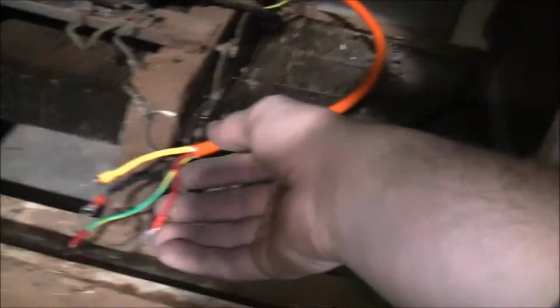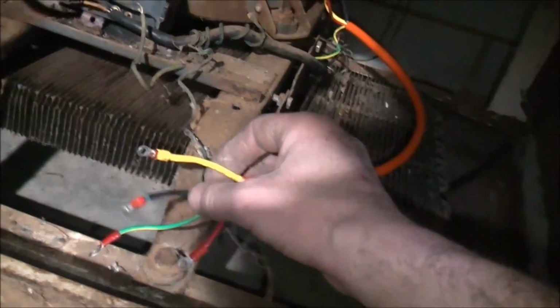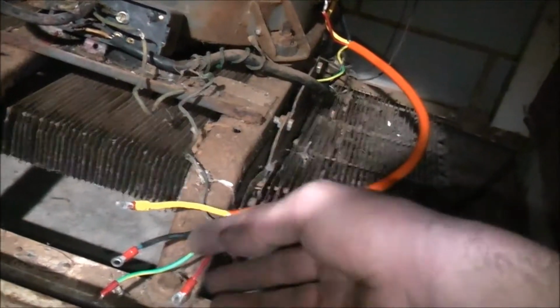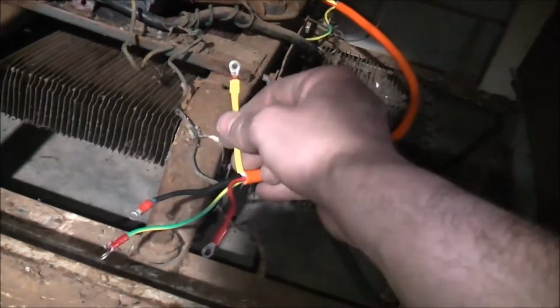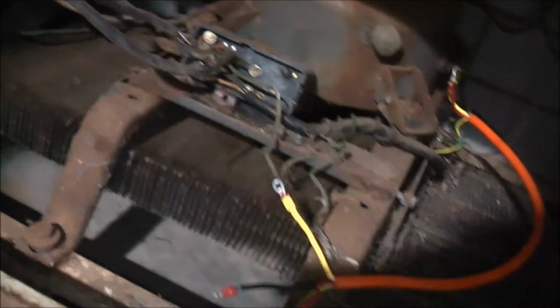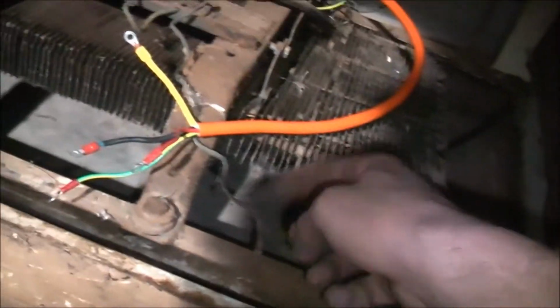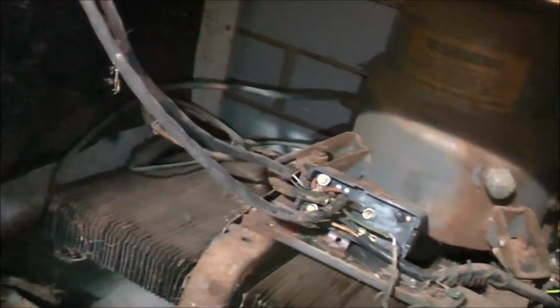I've used good 3-phase cabling. That's just for the compressor one. So I just recolour coded the white to yellow and blue phase to black. So I'm going to do start for the compressor, run, common, and earth. I'm going to make quite a few earthing bonds here. I'm going to replace all this old earth wire with new.